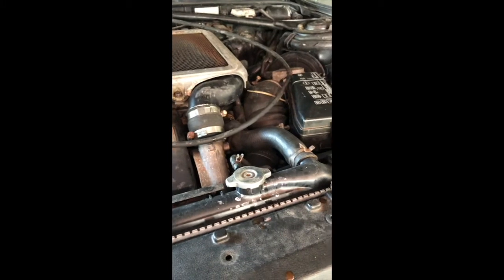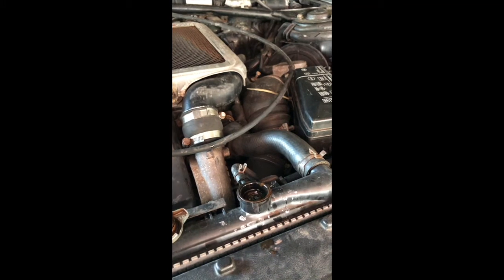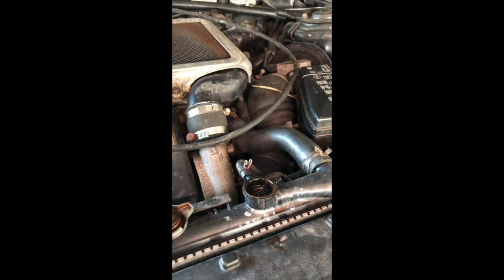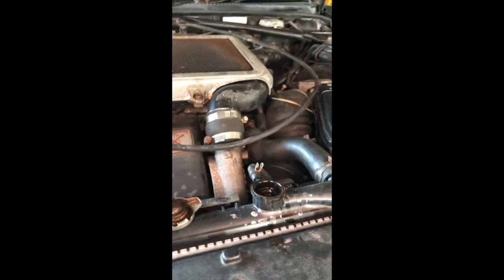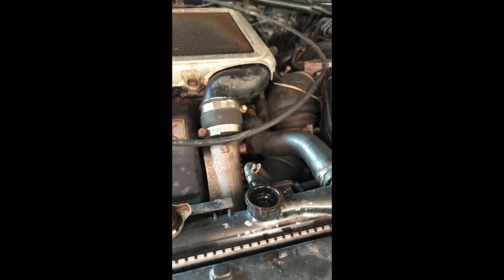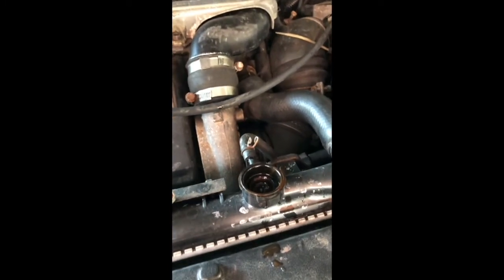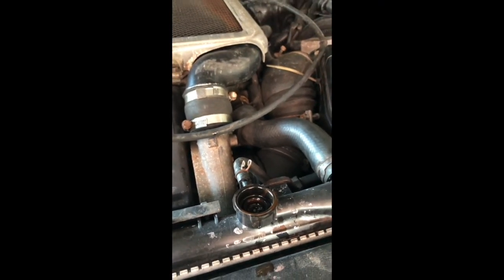And then now, we're gonna remove the cap and drain the coolant, flush it with some fresh water, and then drain it again. And then fill it with distilled water and hopefully get rid of some of this muck that's in the system. I'm hoping it's not a sign of a head gasket, but again, let's start with the basics and something simple. It can just be years of abuse, not changing old coolant, maybe he hasn't even put coolant in it, or he's mixed the wrong coolants together and that can give you a sludge as well. It's not oily, so I'm not thinking it's the head gasket, it's just dirty and it's old, so let's not jump to conclusions for now.